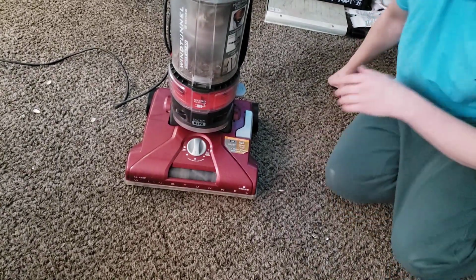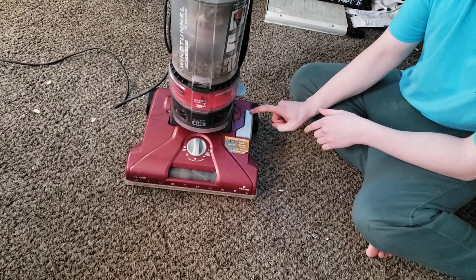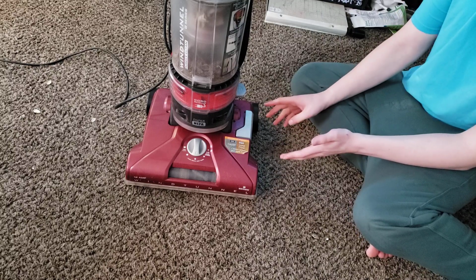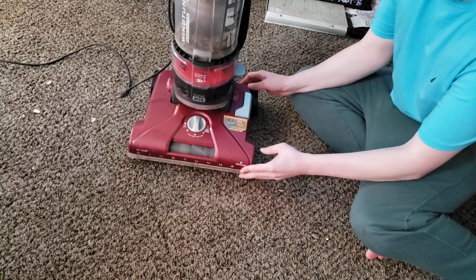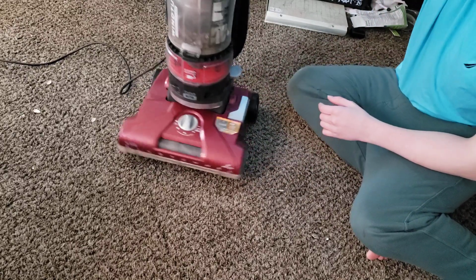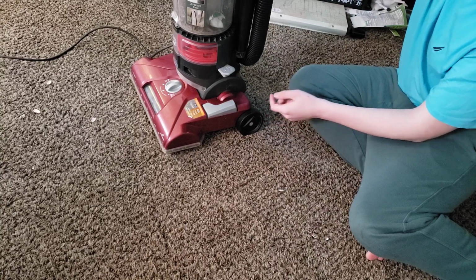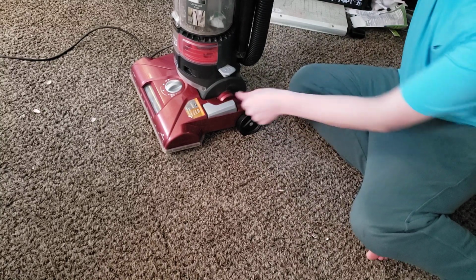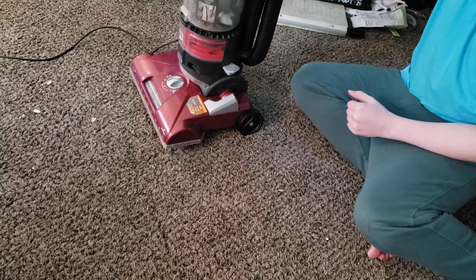So one other thing is that right down here, we have a pedal to turn the brush roll on and off. Now this machine uses a serpentine long life belt. I will link the belt in the description. I usually store it on the off position, same story with my Tempo. Whenever it's pushed in like this, it's in the off position where you can see the gap right here. That means the brush roll is not spinning. And when you push this button and it pops up like that, that means the brush roll is now engaged.